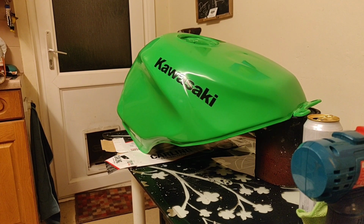But it's about building up. You think of an established paint job on a bike, on a car, on anything. How many times has that been polished? Even before you buy it, but just think, the first owner is going to polish it once a week, probably, maybe even more than that. So even in its first two or three years, you're talking hundreds of layers of polish on there. So you're not going to get that straight away, but you just need to give it a good start. Right, so speaking of good starts,